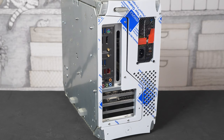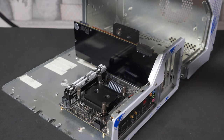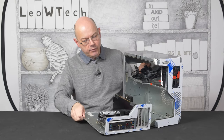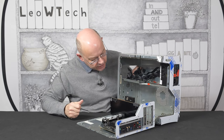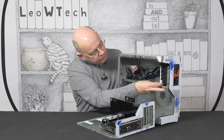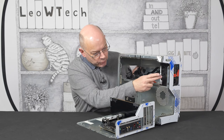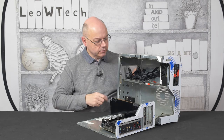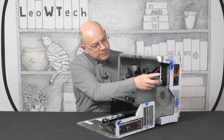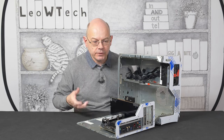That's the two LaserHive panels installed in a trial fit. They've still got their protective film on the plastics — that peels off when we've finished. Motherboard and graphics card are installed again as a temporary fit while we mark up where other things go, and we have an SFX power supply installed which takes up very little space. The red tape denotes the areas that I think I can cut out of the case — this shelf that extends all the way forward. For now I'm going to leave the piece at the back as a support for the power supply, but the metal from here going forward can come out, which means some drilling and dremeling. There's also some metal to come out at the back, and then I'm going to look at the bottom of the case for ventilation.